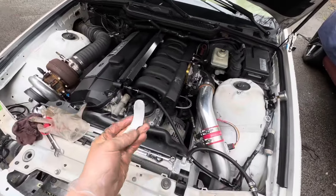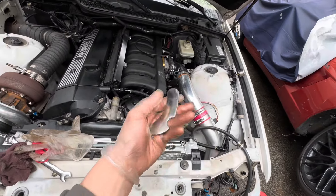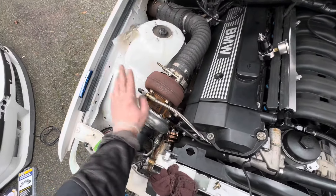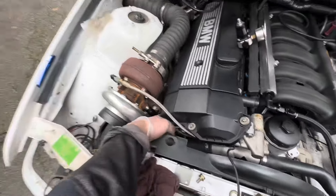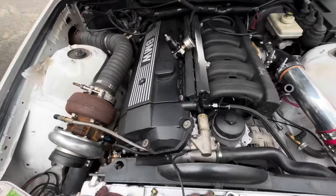I'm going to drill the holes and try to get it mounted up. Probably worry about spraying it or getting it powder coated later, but for now it's just going to be raw. Ran this oil line how I wanted, clocked it how I want - ended up going over the top so I don't add extra heat to it. Got my P-clamp on so it's all tucked up nice and tight, won't be hitting the fan.